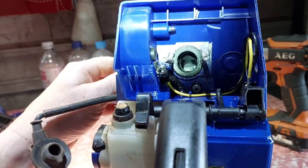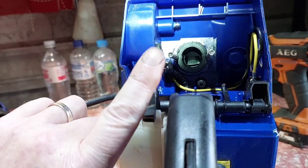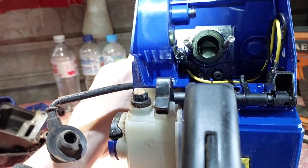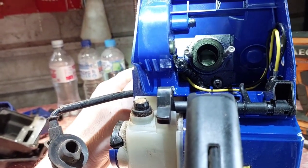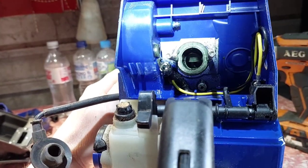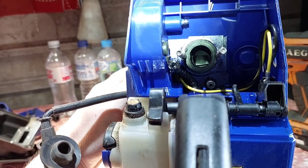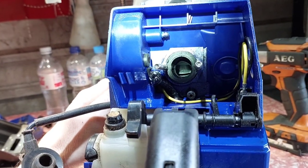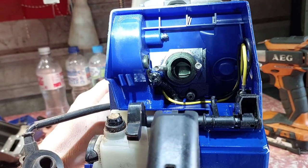So this will be a blind port — see how it goes. But I want to actually take more off the top as much as I can. So when it is open, it's got more time to suck, and more time to compress the fuel and air in the sump. Because the moment you go further down, there's less time and you get spit back. So I'm wondering if I can remove more from up the top and as wide as I can, to get more chance to have more fuel in the sump than normal.